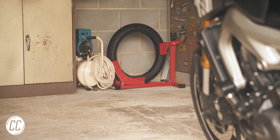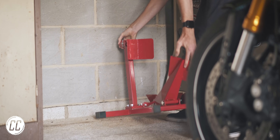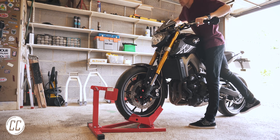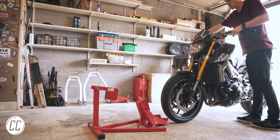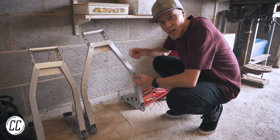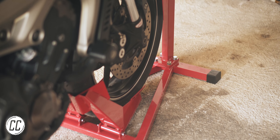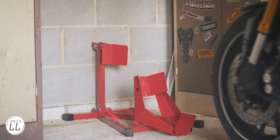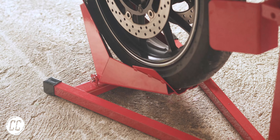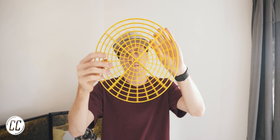However, I got this specific one because it supposedly didn't need to be bolted down, and I like the idea of being able to move it around. But it doesn't quite work as planned. It needs to be propped up against something when putting the bike in so that it doesn't just slide away from you, and requires a special technique to coax the bike back out. There are also a few things to remember before trying to remove the bike: make sure it is not on a paddock stand, the safety hook is not down, and the bike is not in gear. Nevertheless, I'm confident that once I master the required techniques, it will be my new favourite way to park my bike, and I've at least ticked this strange long-time desire off my wishlist.